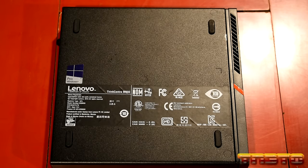And it's going to keep saying, well, if you don't have internet, you can't do this, you can't do that. We're going to limit you, blah, blah, blah. So they're going to keep pushing you to connect to the internet. So you are forced to sign in to a Microsoft account. But we're going to say no. So you click continue with limited setup. Now it's going to say who is going to use this PC. GTAXL, next. And we're going to create a password on it.